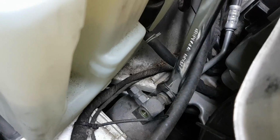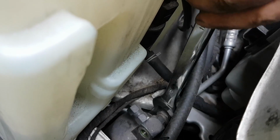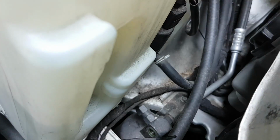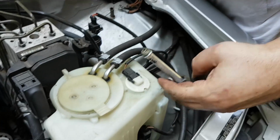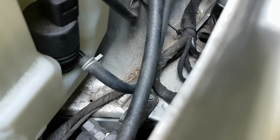Next, you use I think a 19mm wrench to remove the pressure line on the other side of the pressure sensor. Be sure to recover the rubber gasket and then cover the end of this line with something. I use aluminum foil to cover it. Depending on the age and condition of your rubber gaskets, you may be able to reuse them. I suggest you replace both gaskets though.